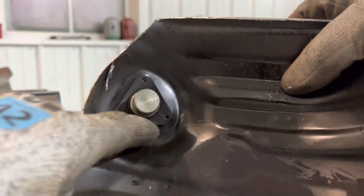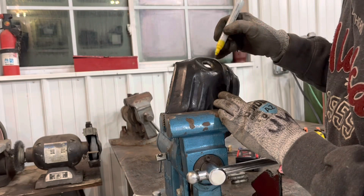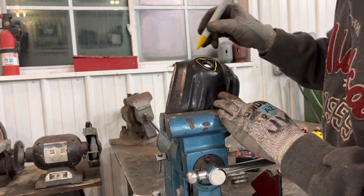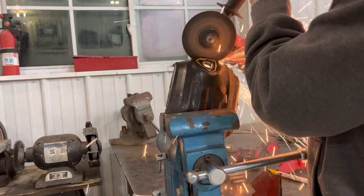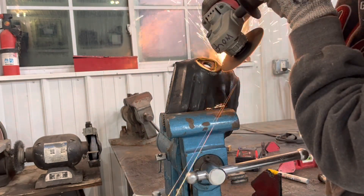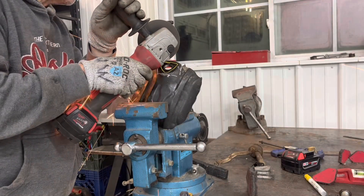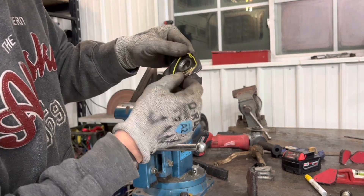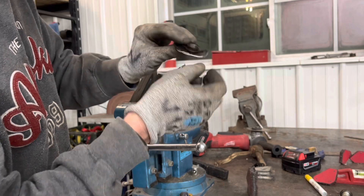It's got a triangle piece inside here that I'd like to cut out. If you want to save a couple bucks and you don't have a weld-in drain plug on hand when you're doing this project, you can cut that drain plug out of the old pan and weld it into your new shortened oil pan. I'm going to pound this flat, maybe cut it off a little bit, cut the corners, pound these corners down.